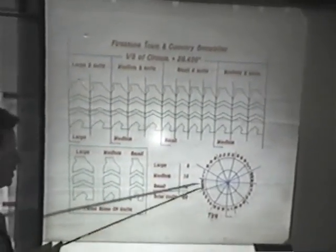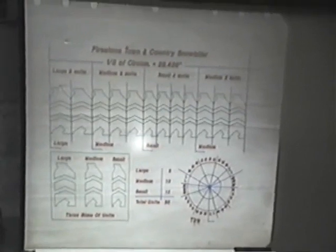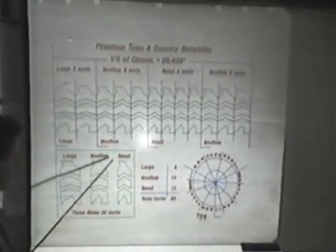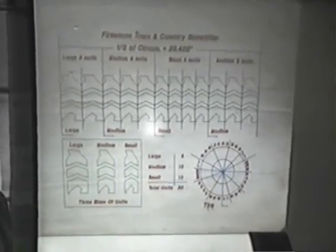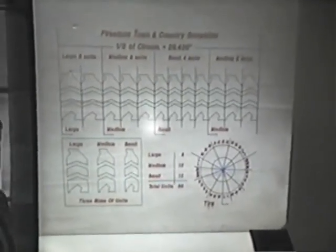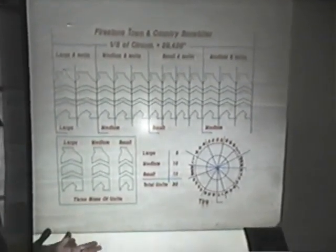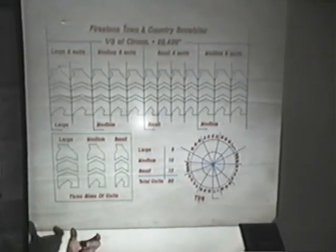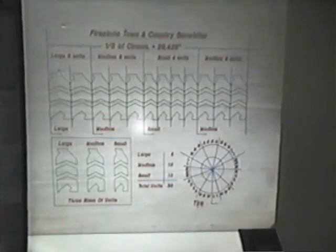And this is the same order they're going to be in no matter what the size of the tire, whether it's a 13, 14, or 15, it doesn't matter. All they did was make these pitches a little bit larger for the larger size tire, but keep them in exactly the same order. Sometimes that's the case, and that was the same with the last tire we just looked at, 1, 2, 3, 4, 5. It didn't matter what size, it was always the same pitch sequence. They just shrunk or enlarged it, depending on the size of the tire.